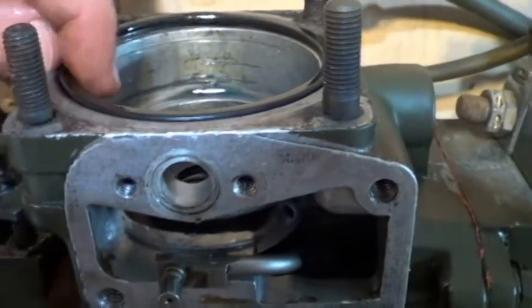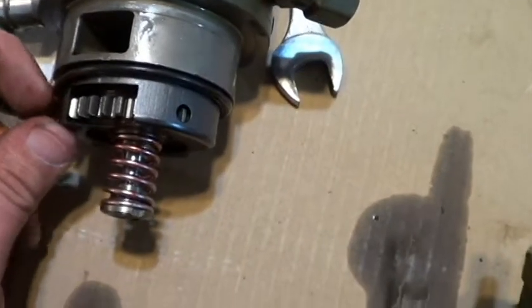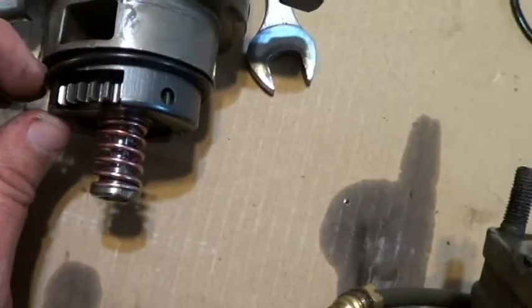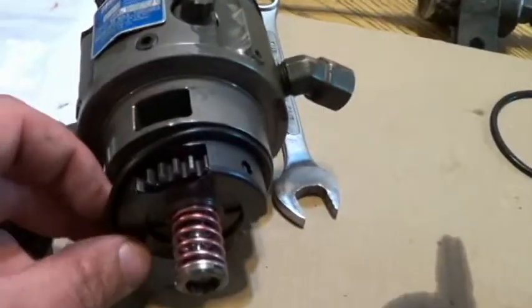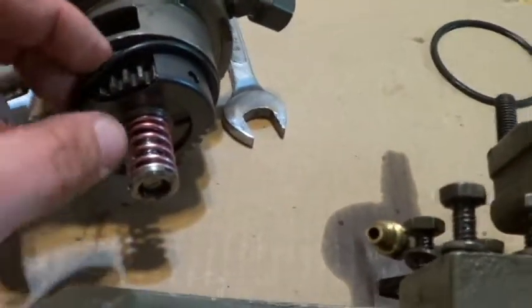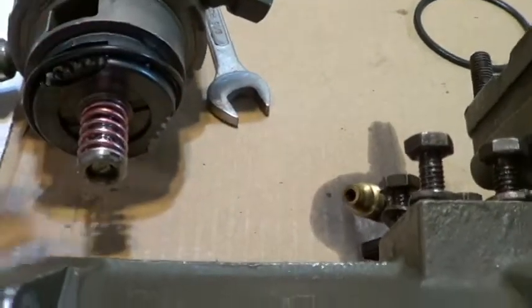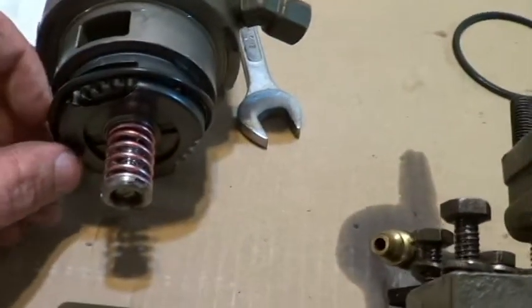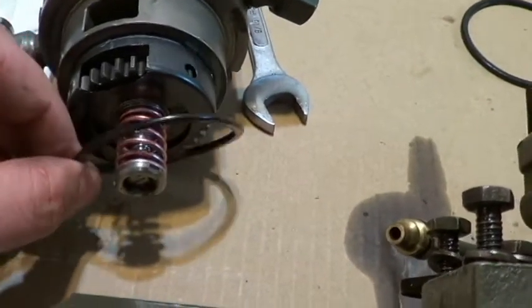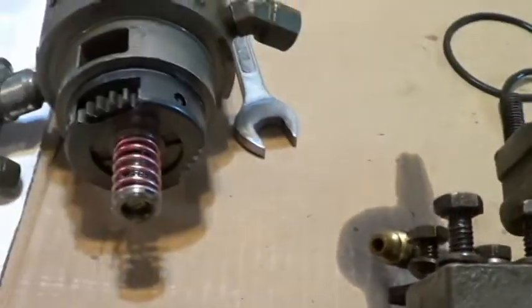The parts I'm changing today are the O-ring on top and one on the bottom. This stops it from dropping diesel fuel down into the pump. If you're checking your dipstick every once in a while and you keep getting oil and it climbs on your dipstick, it's referred to as oiling — basically you've got a leak here with these O-rings. It could be either one of these two big ones, or the little one that fits into the groove for that cam. You can buy a kit online; you usually get all three O-rings.